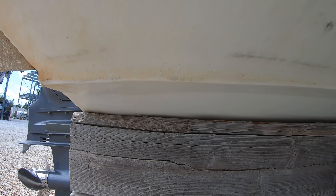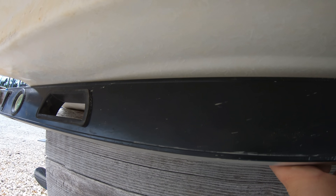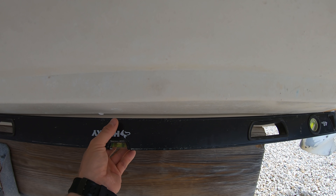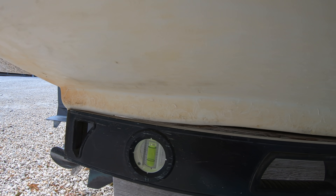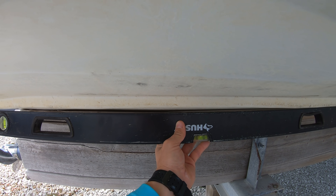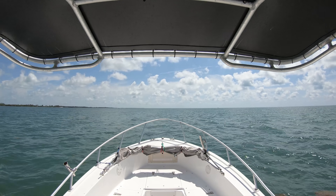With that same concept, if we look at an older boat, sometimes we can find that a boat will develop what is called a hook or a rocker in the hull. A hook in the hull is when we take a straight edge on the last four or five feet of the boat from the transom and find an indentation in the hull — that is called a hook. Then if we find that there is a hump there, that is what is called a rocker. A hook in the hull will take the water running under the boat while on plane and act like a trim tab forcing the bow of the boat down, while a rocker will act like the trim of the engine, pushing the bow up and making the boat porpoise through the water. There are all kinds of different reasons for a hook or a rocker to develop, but it is something that can happen and will make the boat perform with this porpoising effect.